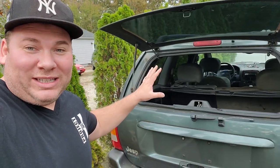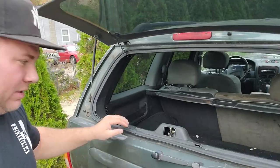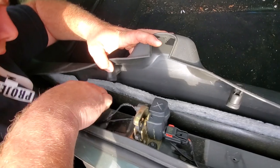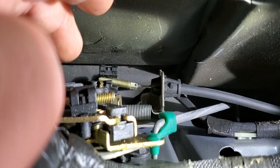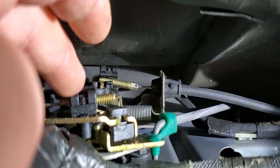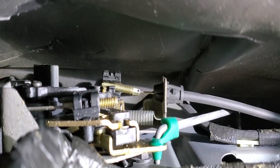Back to Dan — that was a really easy fix. All you need is two tools: vice grips to prop up the flip glass and a screwdriver to take out the screws. Once you're inside you can bend the panel forward and find the problem — just like the XJs and ZJs, that little tiny threaded rail comes off its clip. That's the culprit right there. And WJs have two of them — one for the left side and one for the right side.